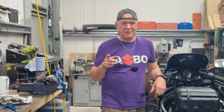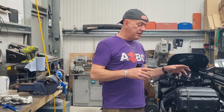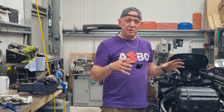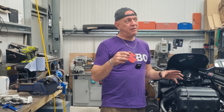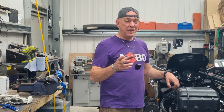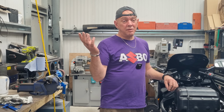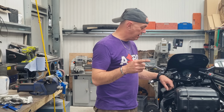So, just to recap, this is what's happened basically. On the way home it sounded like it was running on 3, and it definitely felt like that, at low revs and at higher revs as well. So to me, like Andy says, most carburation issues are electrical, so that's what we started on checking.